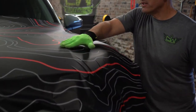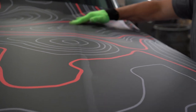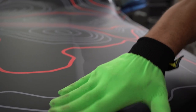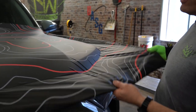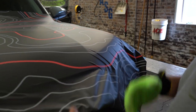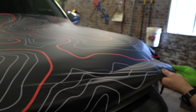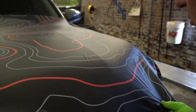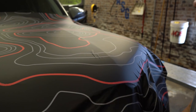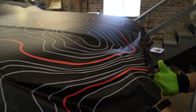We're going to go to this next ridge and set it right here — this is our high point. Making sure we've got a good clean set on each high point. From there, I'm going to make sure this thing is glassed out. The way we're going to start: we have our center loose, everything's loose, all we've set is our high points. I'm going to come right to the middle and set along this edge, moving any excess vinyl towards our corners.